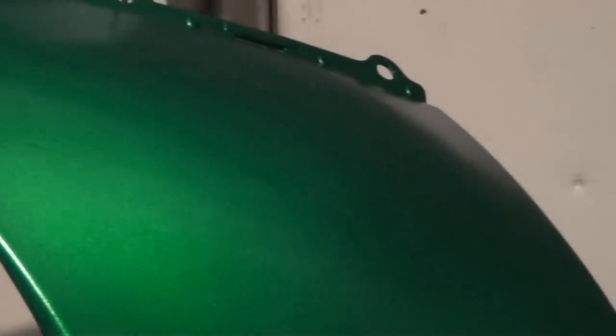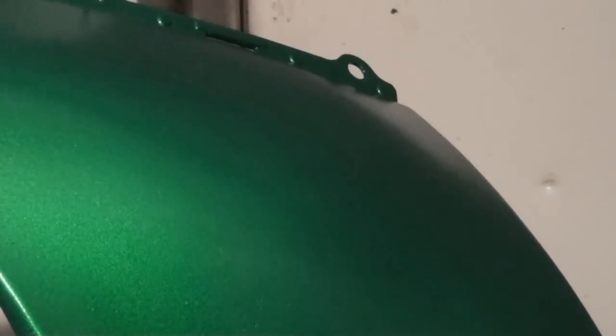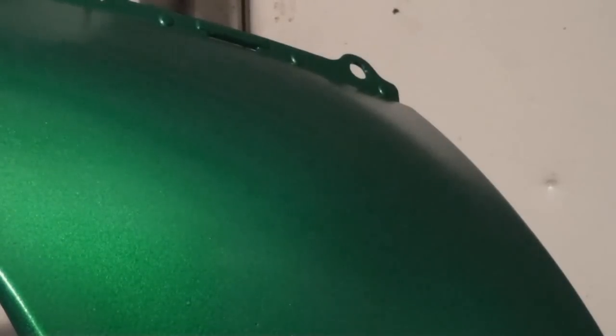It didn't look too good at first when I started spraying, but now that it's cool and it's starting to flash off, it's actually flowing out. You can see on the camera pretty much the silver base on the bottom and then the candy. Now if you can see, it kind of looks black in the dark — that's very good. I like that because during the shades, when the bike's in the shade, it's going to look like a black but it's going to have its own unique color, and then once the light hits it, it's just going to explode with color. I could get away with just clear coating this straight, but since I want a lime green to it I am going to be putting some flakes over it.